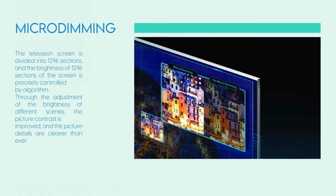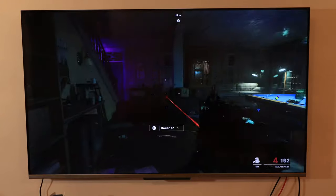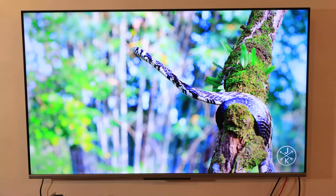A big part of the picture quality comes from the micro dimming feature. Micro dimming tries to achieve a similar outcome to local area dimming without actual backlight zones — instead, it adjusts contrast across approximately 1,296 specific zones on the panel according to the image. In a really dark scene it's very effective — most of the TV looks totally black, and the bright parts of that scene stand out well. In daytime scenes without many dark areas, you probably won't notice the difference.